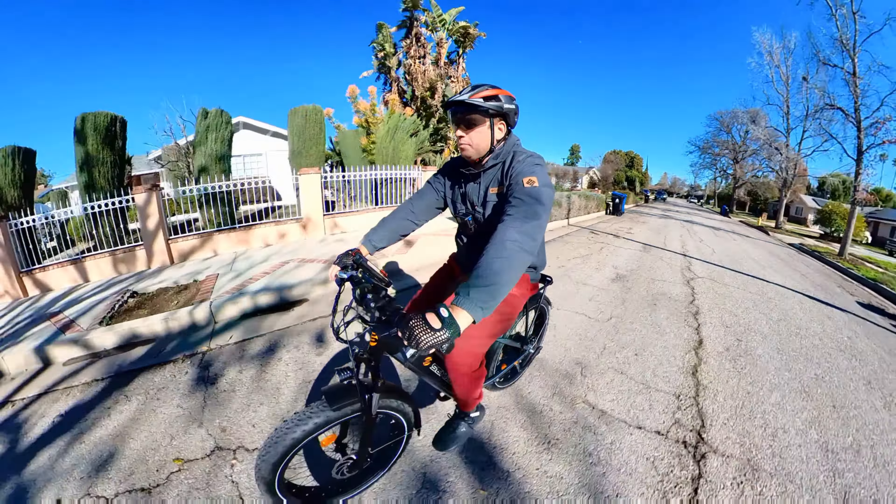I've already tested the brakes briefly and I can say there's a little bit of improvement — maybe about 10 percent better stopping power — but not a huge difference between the Saber and Saber Pro. The bike handles the road noticeably better though; I can feel right away that the wider handlebar makes a big difference. If you have a regular Saber, I recommend upgrading the handlebar for a better riding experience. The wider bar gives you better handling and a better riding position — you can also raise it with an adjustable stem for about 20 bucks.